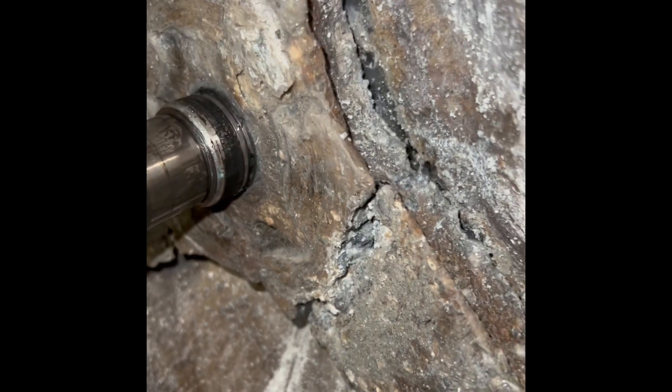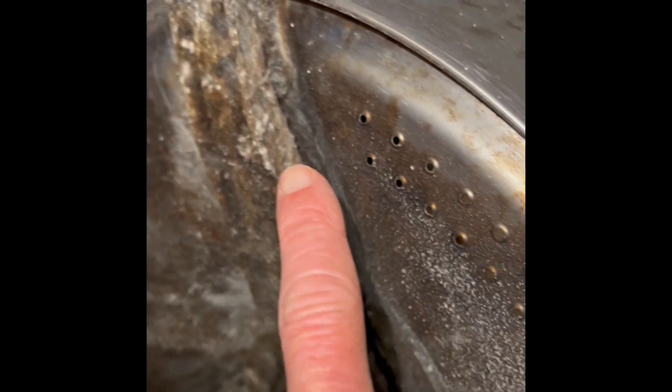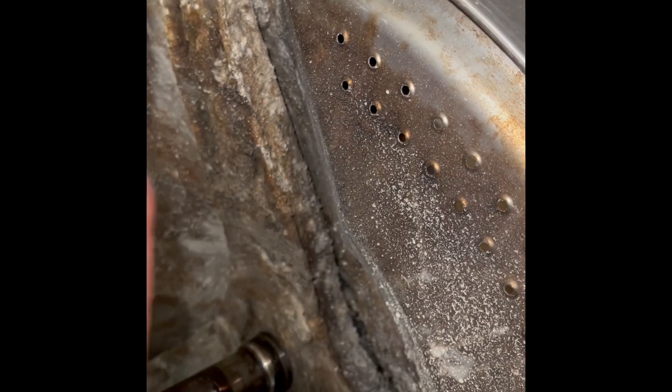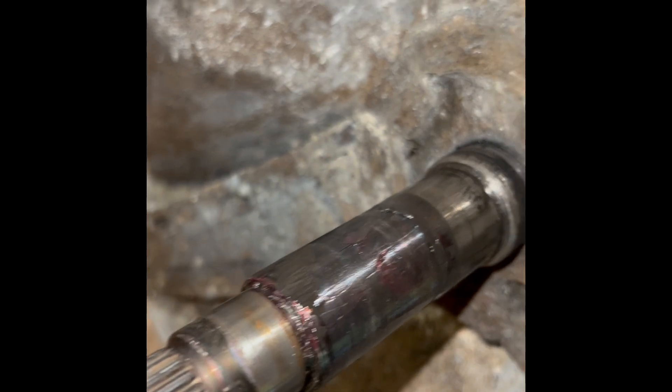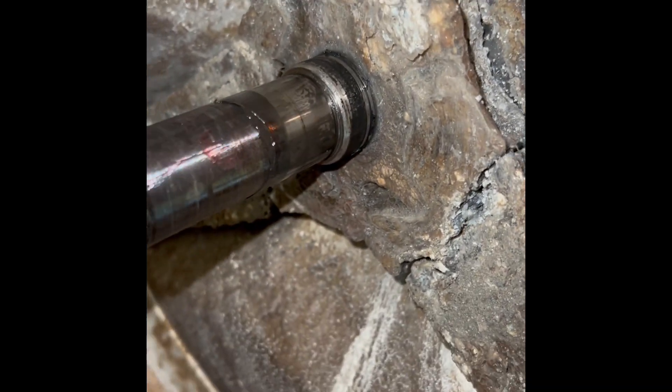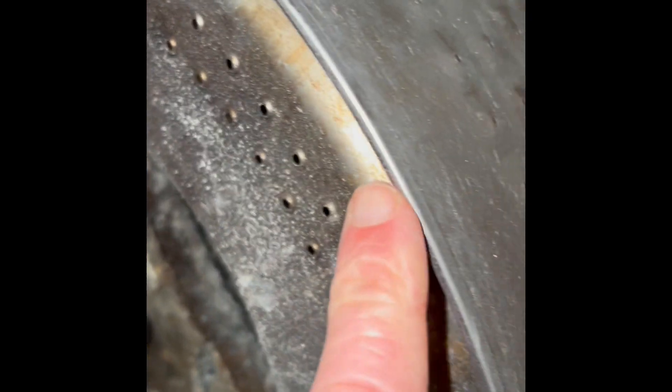The spider bracket is made of an aluminum alloy combined with a stainless steel tub. Because of the aluminum and stainless steel together with corrosive detergent and water, it corrodes over time, developing micro-cracks. Something heavy in the spin basket — like a blanket — can cause it to crack. Once cracked, the spin basket is no longer supported, so it clanks around and tears into the plastic tub.